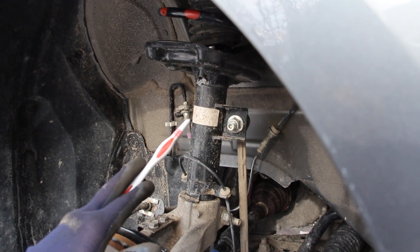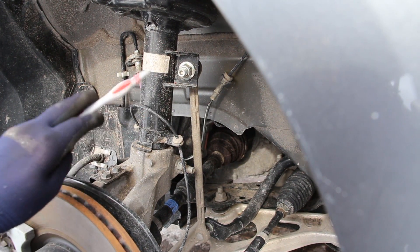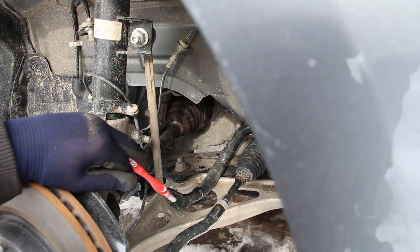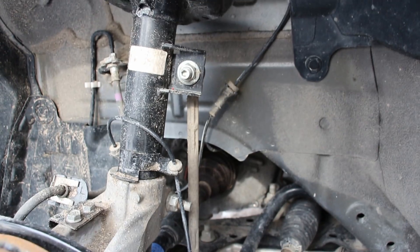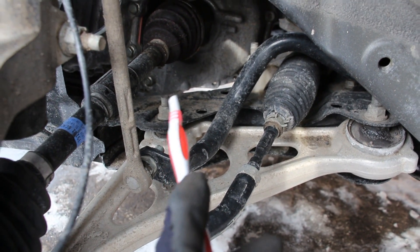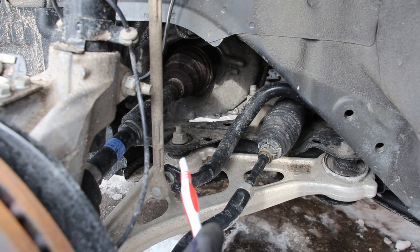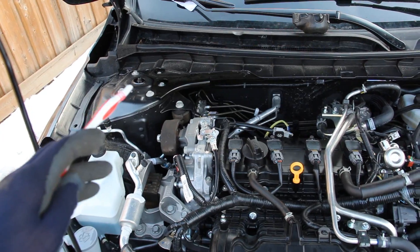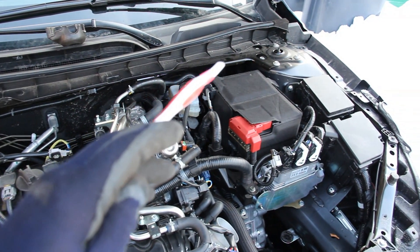The front suspension on the Altima uses a McPherson strut on the top here going into an aluminum knuckle. However it does use a pinch bolt, which I don't like, because come time to replace the strut it's going to get rusty and get stuck inside of the sleeve. At the top of the strut we have an aluminum sway bar link where it attaches to the sway bar. We have a lower aluminum control arm and the inner and outer tie rod end. The front suspension should be pretty easy to work on. Now the front lower control arm bushing is facing the up-and-down direction contrary to the sideways direction that most OEMs are doing — this was a problem point in some earlier Maximas and Altimas. Luckily the front bearings are also a bolt-on design which is easy to change. The Altima's strut tower is actually built into the windshield cowl — there's this thin stamping that runs from either side and bolts into the top of the strut.